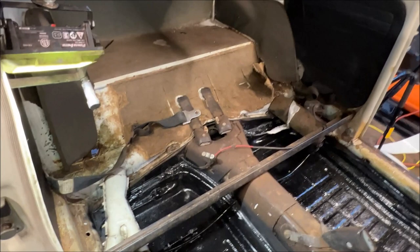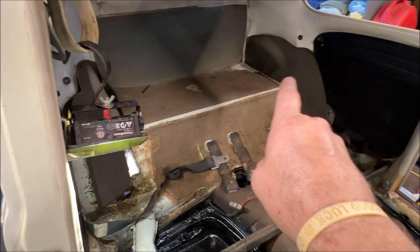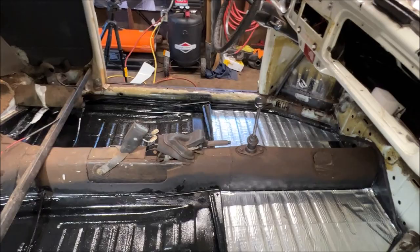Next, on part two, which is not going to be right away, we'll be pulling the door cards off the back, doing a couple strips inside of there, the wheel well, very important, and then the luggage compartment. Okay, and it makes a huge difference, trust me. That is sound deadening part one. That is just the floor pans. I like to double layer, because I'm telling you, it just helps a lot.